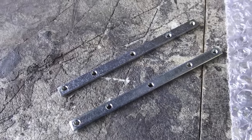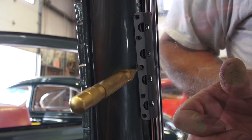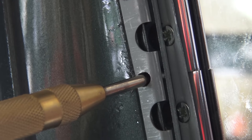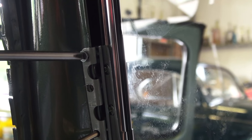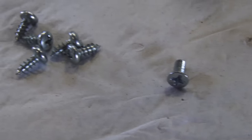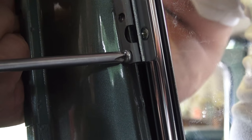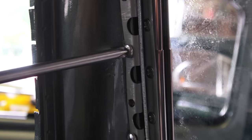Here are the screws you're going to need to fasten into these plates. Once you put the plate behind there, grab your punch or a small pointy implement to keep the fastening plate from moving. Insert the punch to hold the plate steady. The machine screws they give you have a hard time catching the plate because there's no point on them and they're fine-threaded. I prefer to grab #8 sheet metal screws — I believe a half-inch — because they have a point, get into the hole, and pull that plate right in. This is especially helpful later when the headliner is in and the cloth is on the door post, making it very difficult to use the machine-threaded screw.